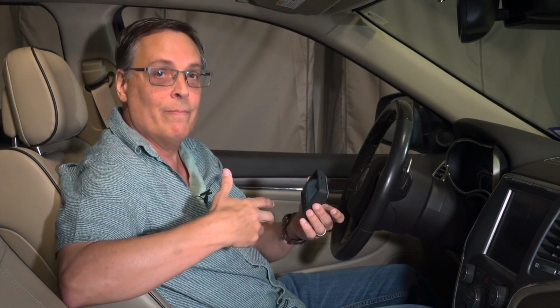Parking mode, when it's properly implemented, basically means that when your car is parked, your dash camera will go into a hibernation mode where it's waiting for something to happen. So say somebody wrecks into your car or somebody breaks into your car, that will trigger the dash camera to turn back on, continue recording, and with a proper implementation, it'll usually also have buffered up 10 seconds of video before that incident occurs. So it will record 10 seconds before the impact and then usually about another minute after the impact. Proper implementation.